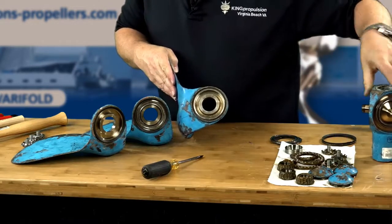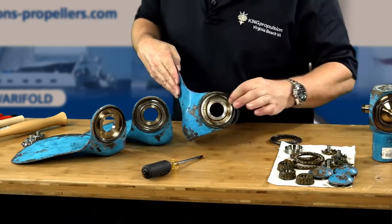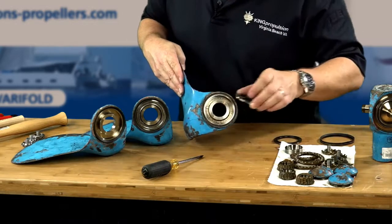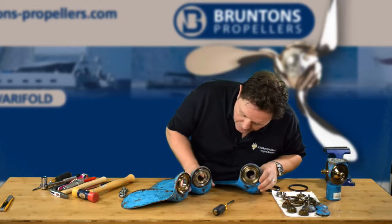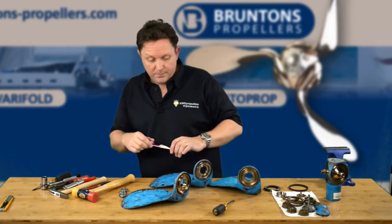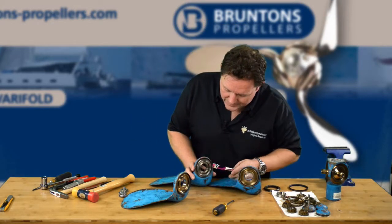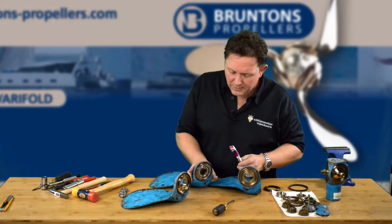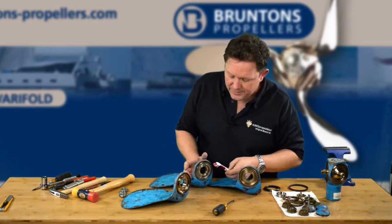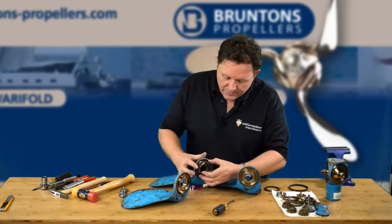So this is what it should look like when it's finished. We've taken the lip seal off that sits in the groove — that just comes off — and then this comes out here. The way I did this is basically with a toothbrush. The thing that's holding it in is the grease, so lots and lots of hot water, even boiling water, and you're scrubbing away at the grease under the sink until you start to get the track to move.